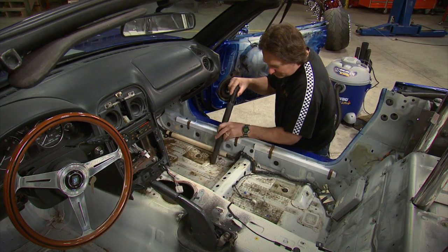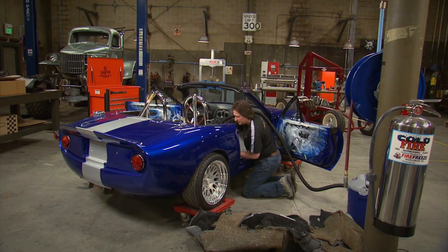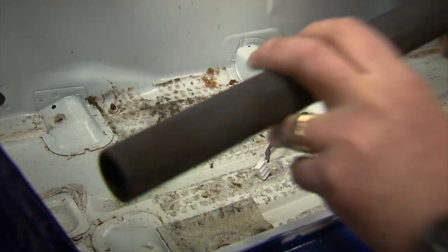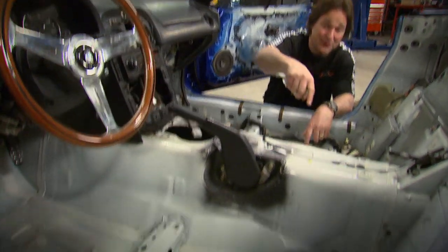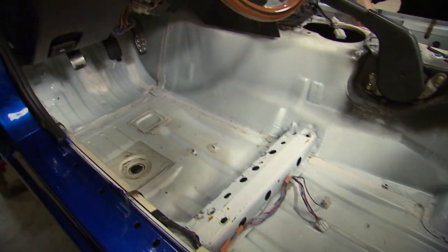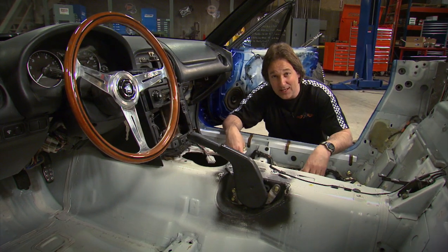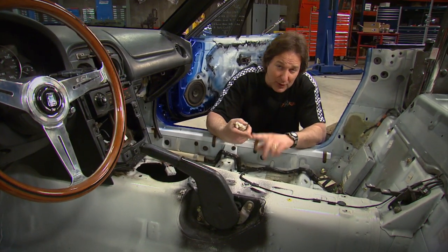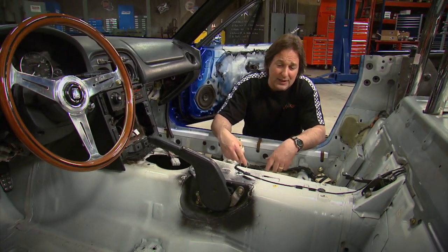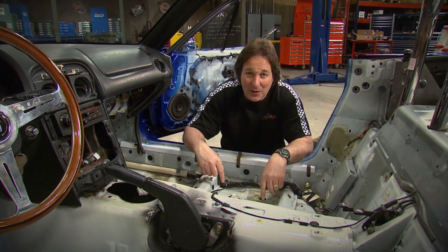The only thing left to do is clean everything up. We really lucked out with this car — take a look at the floor, there is no rust on this thing. Now, obviously if you have rust in the floor you're going to have to cut it out and repair it before you can put the new carpet down. But if you just have surface rust, that's a little different thing. You can get a rust inhibitive paint like Bill Hirsch Miracle Paint, POR-15, or Chassis Saver Paint. All you've got to do is paint it on — that stuff will stop rust in its tracks. Then you're going to be ready for your carpet.